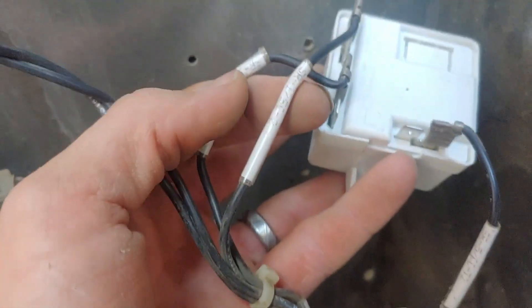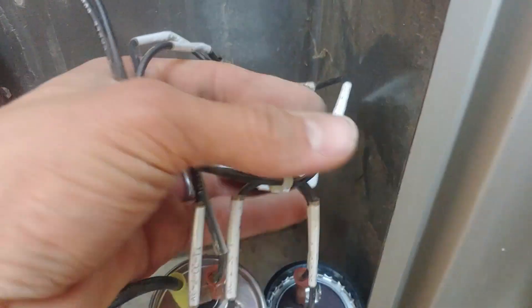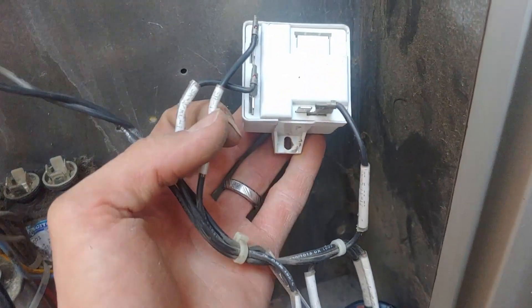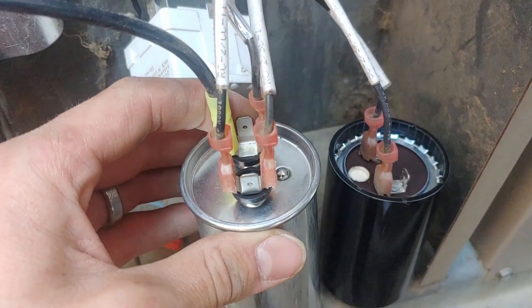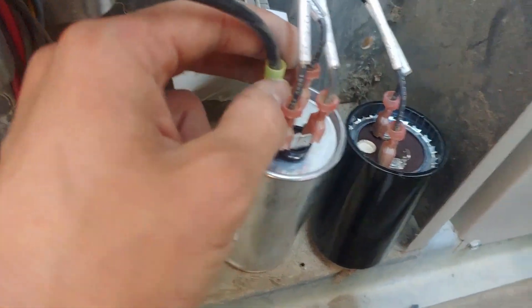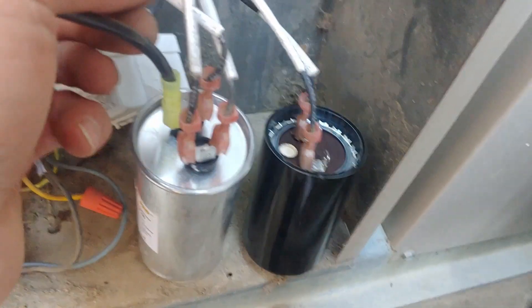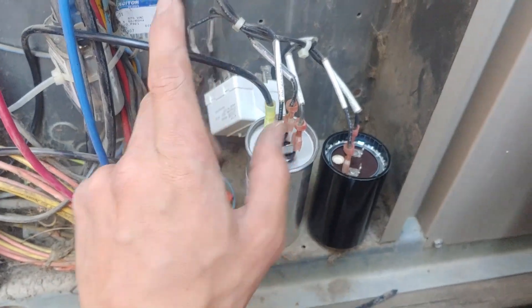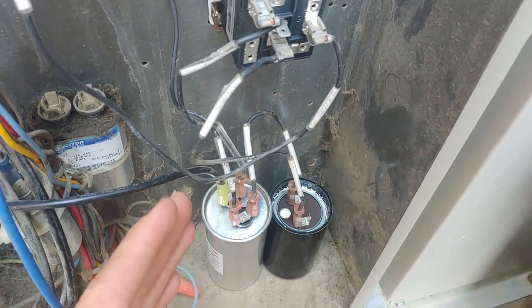All of these are labeled so we can see SR-2, SR-1, SR-5 — so that's start relay terminal 1, terminal 2, and terminal 5. Down here it's labeled for run capacitor 2, so those go on the second terminal. This other one is labeled as start or run capacitor 1, so that's terminal 1. And then this is basically just being used as a wire nut. I followed the wiring through and confirmed that yes, that is the correct wiring configuration for this particular setup.